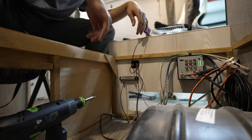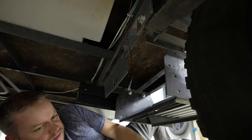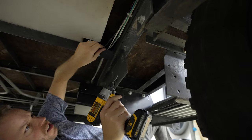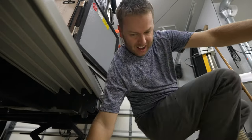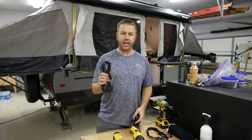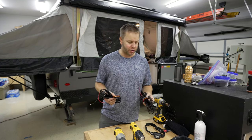I'm just going to pre-drill into the frame for the ground. I knew exactly where to drill because I looked underneath the camper first — don't drill into the wires. Just grab that half-inch bit. Solid connection. Now that we've got the ground wire installed on the chassis, it's time to install our lights, and I chose to go with KC magnetic lights.